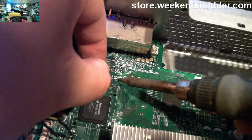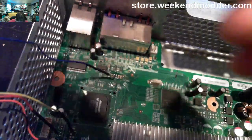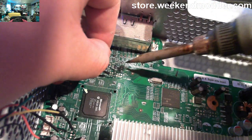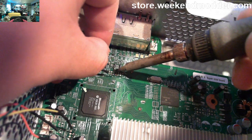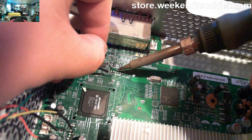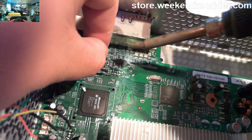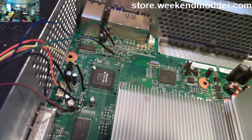All right, so now we're moving to the upper header where we have, again, that 6 and 7, the blue and green wires. And then remember that pad to the right of where we're installing, that will be later used as the 3-volt power source. And I'm touching it there a little bit because it looks like I picked up the solder glob off of it, which I can always retin and add later, but I'm just sharing some of the solder between them so that they behave right. So you can see that it's tacked down there, nice and solidly.